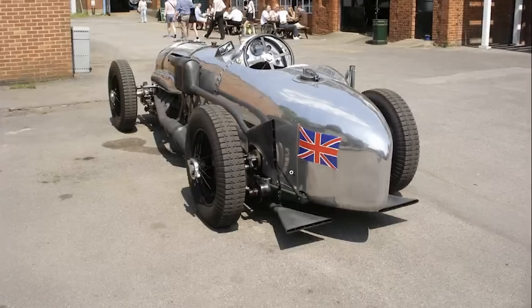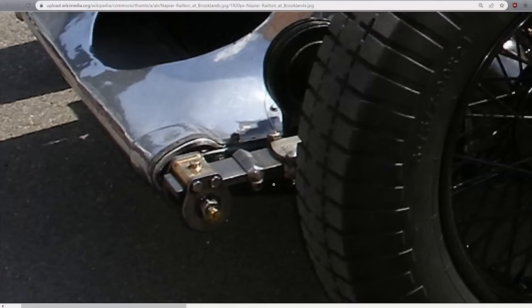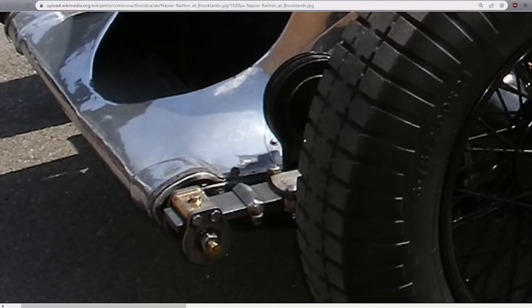So, let's have a look at our suspension setup. Does go in during the bodywork area, and then a single leaf spring sort of setup, which is kind of confirmed around here, and that looks like a friction shock absorber. Let me clarify what I mean by that. Early shock absorbers, I mean, originally didn't even exist. Then what they decided to do was do just plates and plates of different sorts of materials like leather, paper, sometimes just metal on metal was the very common sort of one.